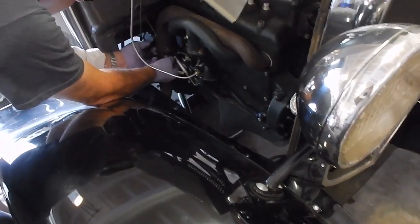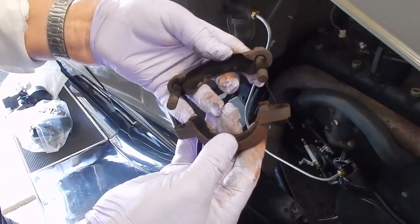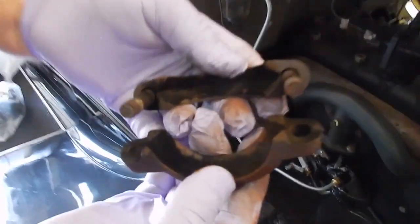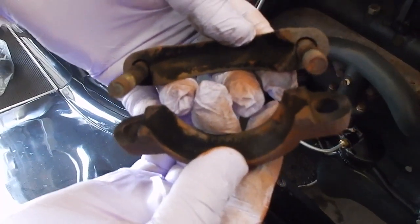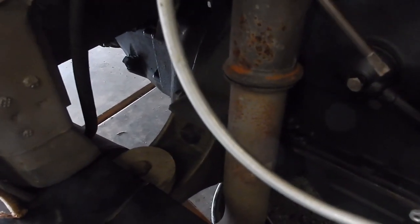We're here at the garage working on my Model A with Bruce of the Queen City Motor Model A Club. He just took off the ring that goes around the muffler because it's been making a hiss sound, which is fairly common. You can see there's a bit of a line there in the ring — these two separate pieces. He says often the gas escapes and that makes that noise.